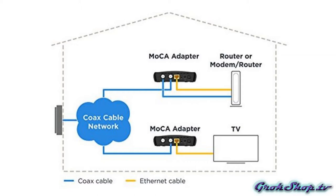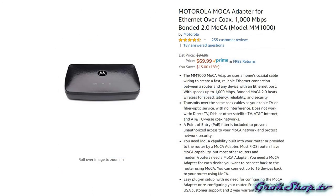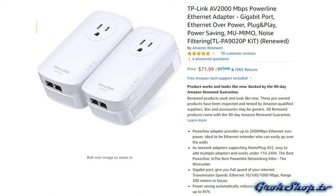MoCA allows you to do networking over coax, and MoCA 2.0 will do up to a gigabit speed. From what I've read, MoCA is compatible with most cable providers, though you may have problems with AT&T U-verse or satellite providers — be sure to check for whatever provider you have. Some routers will even provide one end of the MoCA connection for you and you just need a single box, while in other cases you'll need one MoCA box on each side of your coax. I'll put some links in the description below.